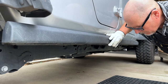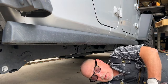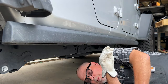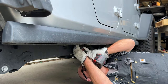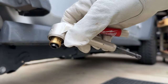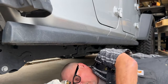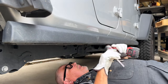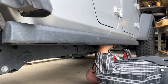I don't have a garage to pull this Jeep Gladiator into a lift, so I've got to do this out in the driveway. According to the directions, all you need is a 10 and a 13 millimeter socket. I'm already in a little trouble because my drill motor is not going to fit between the frame and the pinch weld. What I've got is a Milwaukee 90 degree attachment for the drill motor — let's see if this works, otherwise I'll be forced to hand ratchet all these bolts. I'm going to leave two bolts on just loose so when I get all the others out, this thing's not going to fall down and hit me in the head.